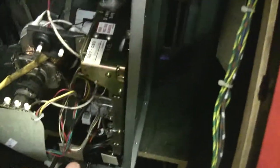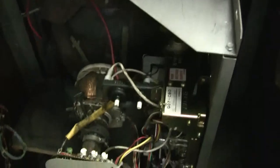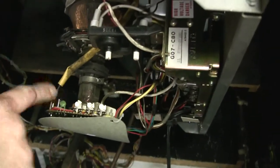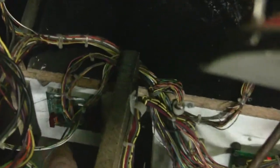We took the boards apart and cleaned all the chips. Here's the logic board — the G07, that wonderful chassis that has all new parts in it. New flyback, a boatload of new parts. There's a new capacitor and a new resistor on the board. You've got to reflow solder though — I can't stress it enough, especially on the steering positioning board. That has to be done. And here's the light controller board — this little board that actually runs just the light bulbs in the front control panel.